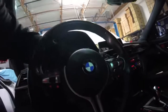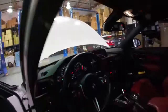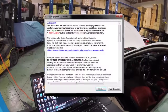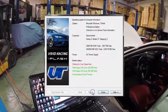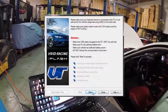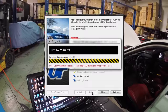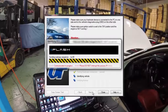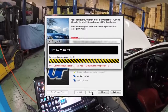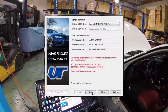We need to turn the ignition on so all the lights are on. We've got the key in — make sure all your dash lights are on, ignition switched on. So now we're going to launch the program, click agree, and proceed through the next steps. It's identifying the vehicle, and with the BMW iFlash it's automatically going to recognize the ECU type. You'll see it pull up the Bosch MEVD 17.2.G.